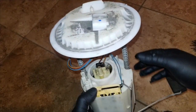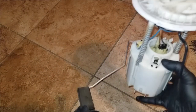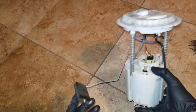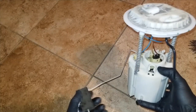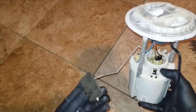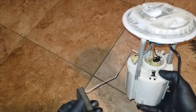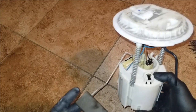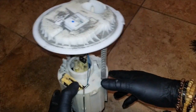Another thing that may happen inside the gas tank: you may have some debris that the float gets hung upon. In some rare cases I've seen where the actual float has been damaged and no longer floats — gasoline gets inside it; it used to be hollow, now it's no longer hollow. So it could be any of those reasons.